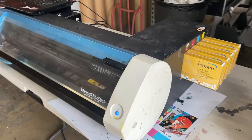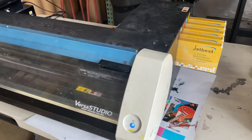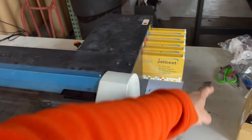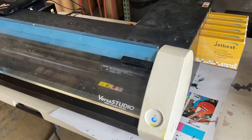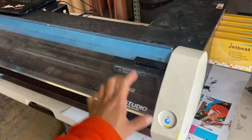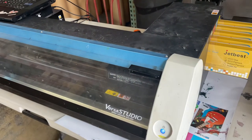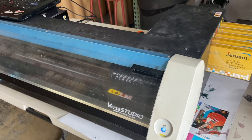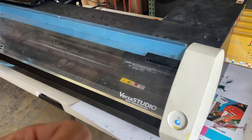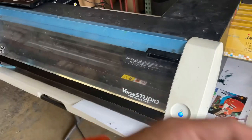Another way is to take off this cover and locate the two lines from the cap top. Take out the cartridges and remove all the ink by syringe — plug one in and use the syringe to suck out all the inks from the other. Now the machine has zero ink inside. Put everything back together and flush the machine with cleaning solution. This will clean up the lines more thoroughly and in more detail, since it's all solution going through the lines with no ink mixed in.